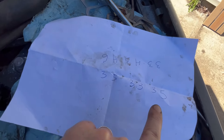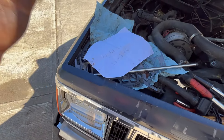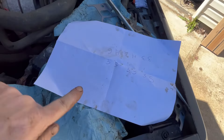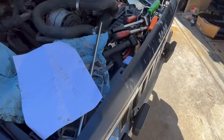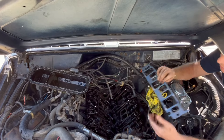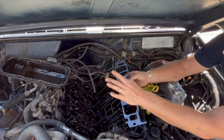Passenger side: five turns, three turns, three turns, three turns, five turns, three turns. That's how I remember what I did — I wrote it down so I can't forget. Also, you can turn the push rod upside down and forget which way it was, so you may want to mark that. After you have all your rocker arms and push rods separated, remember: 'this side up' doesn't mean vertically — it means this side faces outward, away from the cylinder head.